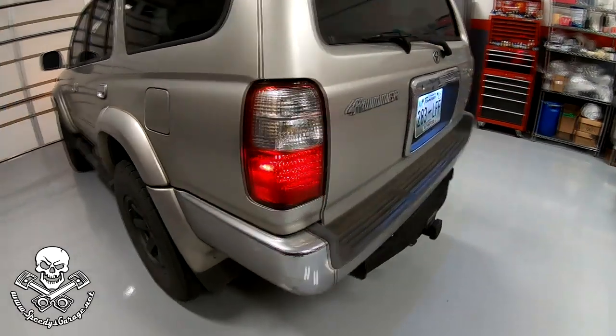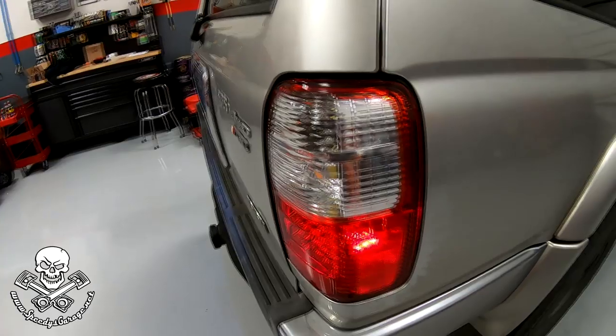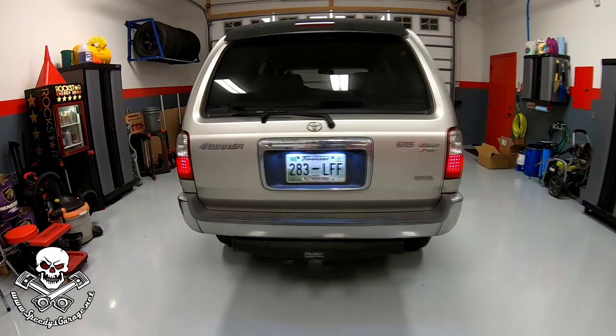Project 4Runner - we got him updated. It looks good with the LED taillights, turn signals, and brake lights. I'm really happy with how it turned out. We got the flasher relay put in so it slowed the turn signals back down like factory. Didn't have any weirdness or extra clicks - I had read those relays can click an extra time after you turn them off, but mine hasn't been doing that. This truck is actually one of the more popular vehicles on the channel - I don't know if it's because of their strong following or their legendary reliability, but I love it and have no intentions of getting rid of it. I realize I'm a little behind the times - people have been doing these LED swaps and taillight upgrades for a long time, and I'm just now getting caught up. But hopefully someone will come across this video and it might help them out. It was the exact kind of project I was looking for on a rainy Saturday in wintertime. I hope you enjoyed the video - please give it a thumbs up. Be sure to check us out on Instagram at speedys_underscore_garage, as well as our website www.speedysgarage.net. Hopefully I will see you out there.